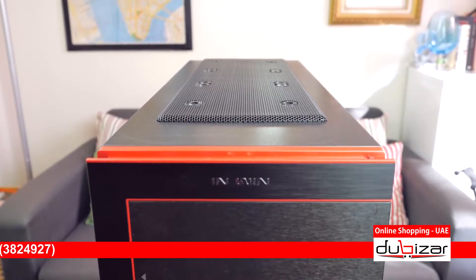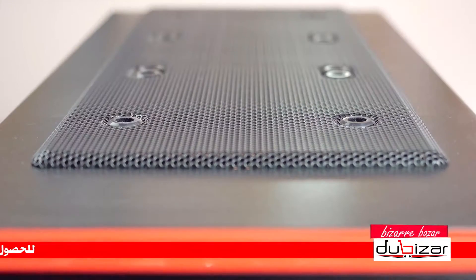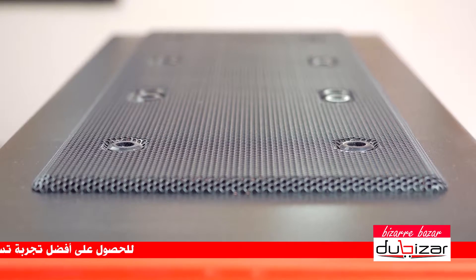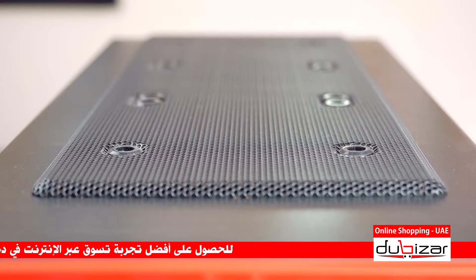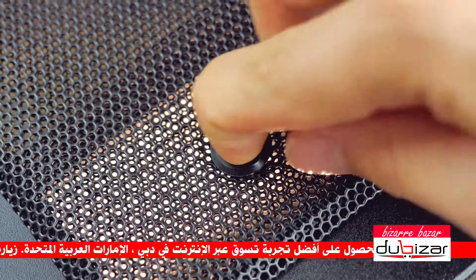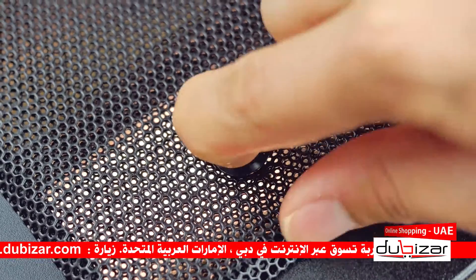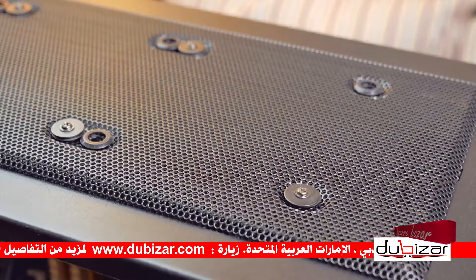While I do appreciate the symmetry up top, we all know the convenience of having those holes offset closer to the side panel for extra clearance with top radiators. I'm disappointed not to see that. Also notice these rubber grommets on all the fan mounting holes — they are quite large, requiring washers to be used, as otherwise standard radiator and fan screws just fall through.